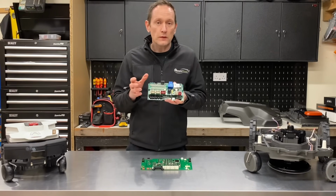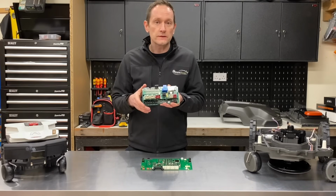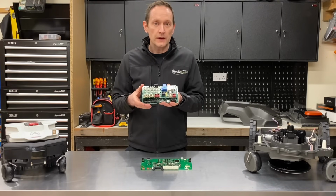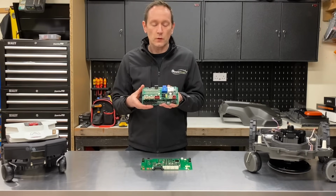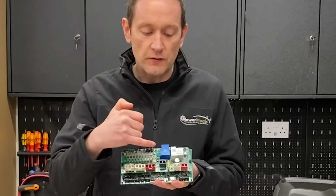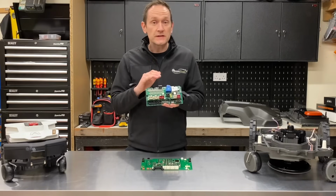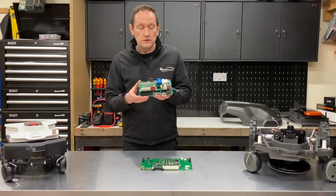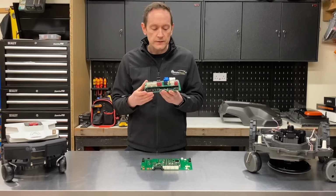That same 2.5 amp hour battery is switched on and off by two automotive style 20 amp relays. Again, loads of redundancy there, it's way over what's required. And there's also some automotive style blade fuses for protection and to allow a bit of serviceability on the board. You don't actually see fuses very often on consumer electronics these days, or certainly not replaceable ones.